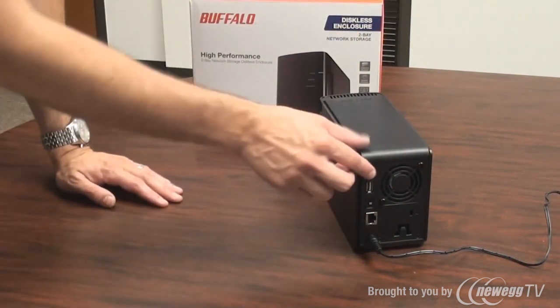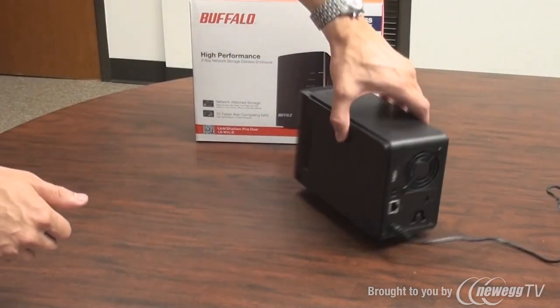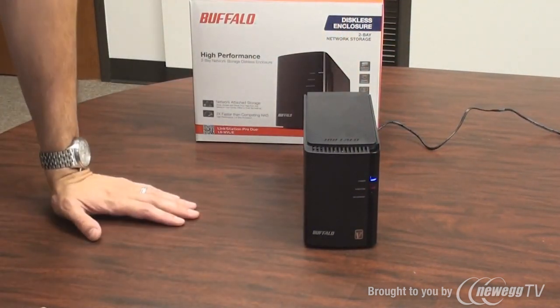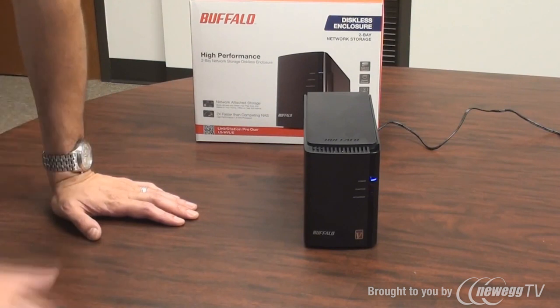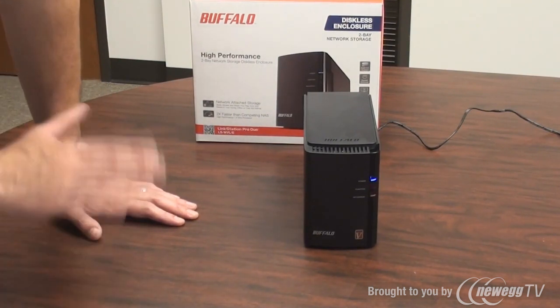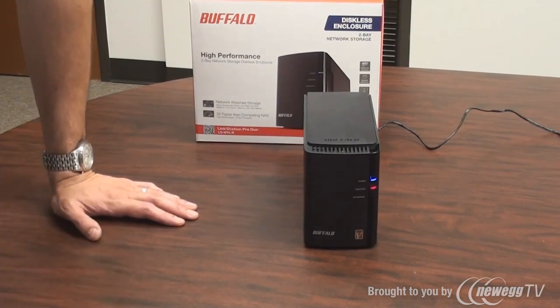What I'm going to do is gently press that function button. You don't need to hold it down — just press it very lightly. You'll notice that the function light is blinking red. This condition will go on for about ten minutes while it's installing your entire operating system and necessary files, swap partition, etc., onto the hard drives. Just sit tight until the device goes through a complete reboot. Then you'll see the power button start flashing again in blue, and once the power button goes solid blue with no red indicators, that completes the transfer of the system to the drives.